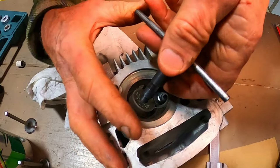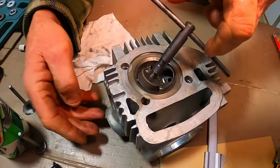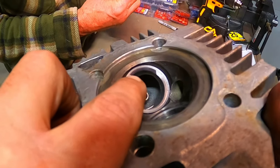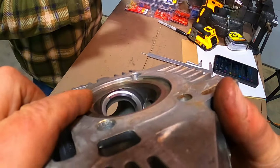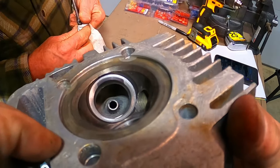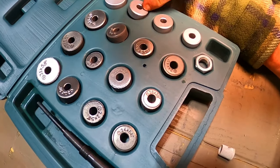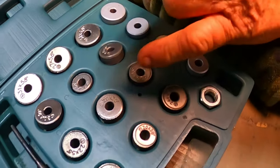After you cut this, you use the adjustment jam nuts to adjust your valve to the right height, because cutting the seat will make your clearance less on your rocker arm. Then you just adjust it down here to get it back to the right spot. So put some Sharpie in here — the black spot is the original spot, and above that is where the carbide cut the outside angle. The top angle is 58 degrees on this stone. Then for the inside angle we need less than 45, so I'm going to say 30 degrees.